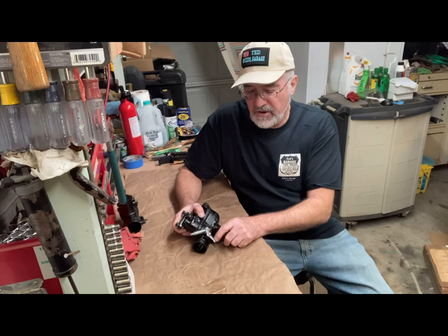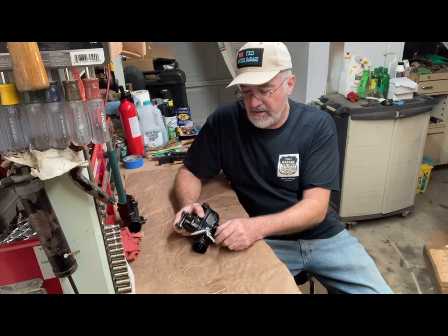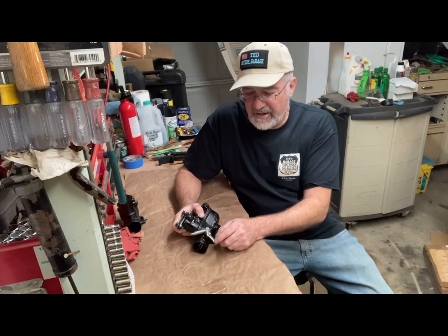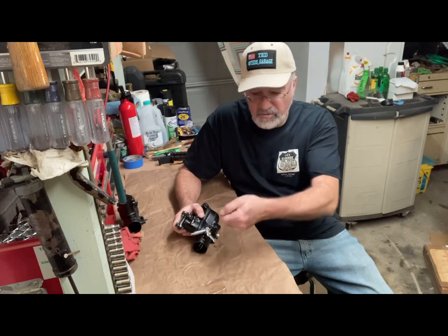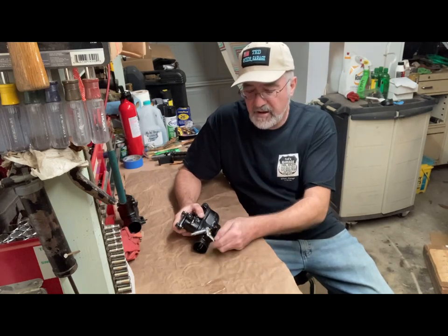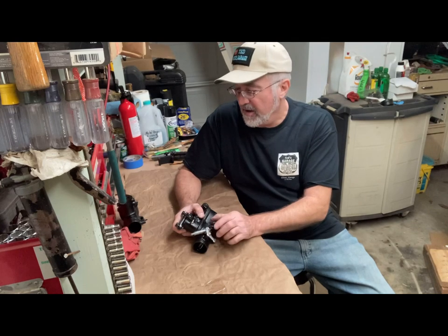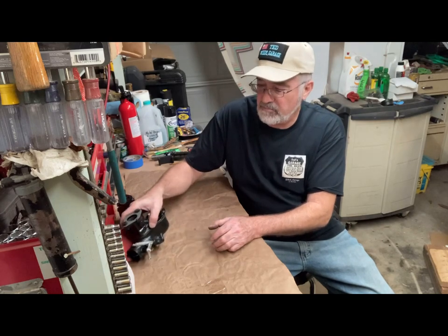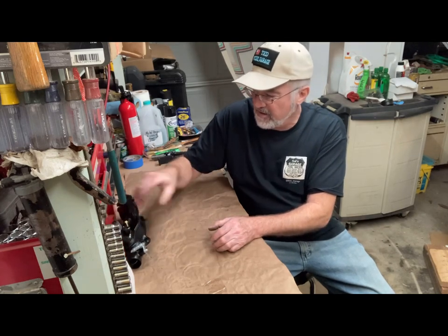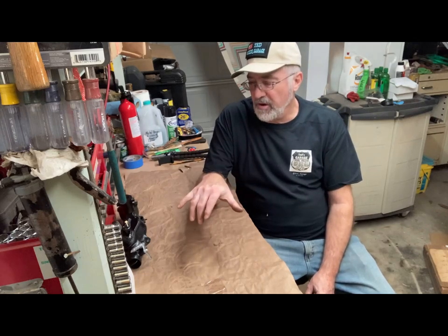And these early ones are very rare. The only ones I've seen, somebody's actually just cut this off. It's not really needed for most people that are using electric starters, because they don't put a wire on it going up to the radiator. You rarely see anybody that has that set up. But that was just an interesting side note. The new one I put on there has that on it. But anyways, I think that's it for the Zenith carburetors.